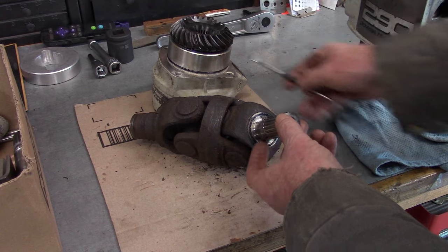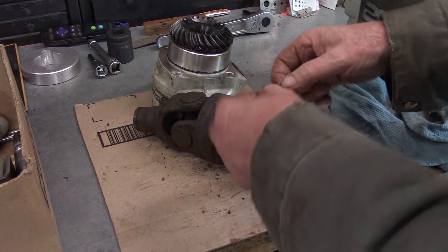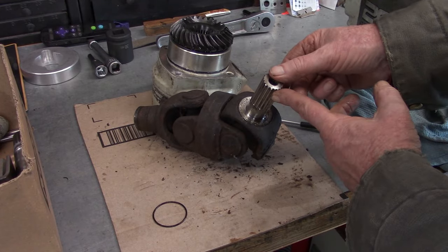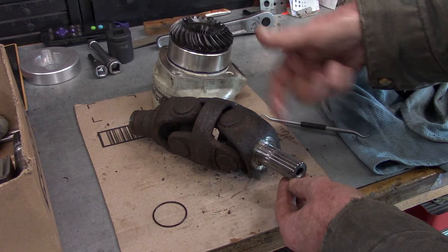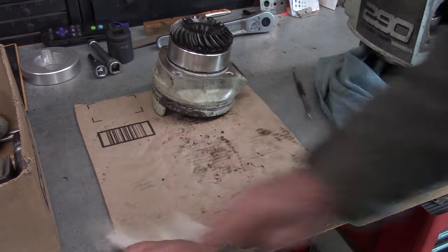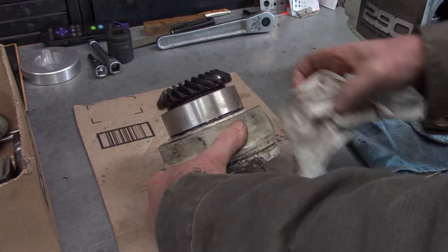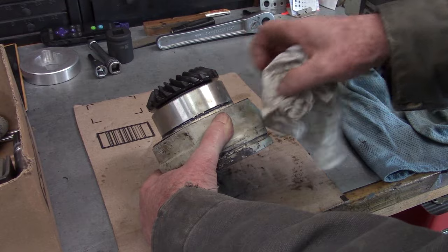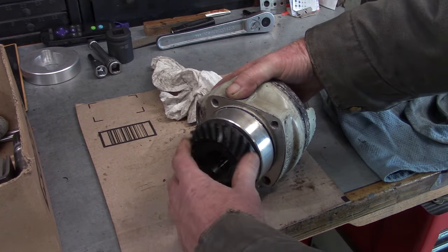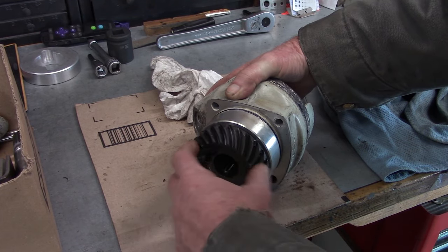There's the o-ring that goes between the u-joint yoke and the seal sleeve. The o-ring looks pretty good, and I can tell this has been holding water tight because there's no rust on the inboard side. Now I want to be really careful not to get any dirt down into the bearings because the bearing is right there. The pinion bearings feel really good — you can't feel any roughness — and they're the ones that usually go out first if you have a bearing failure.